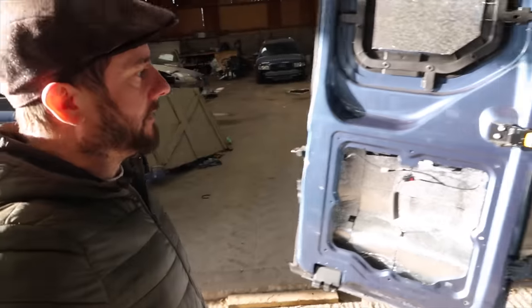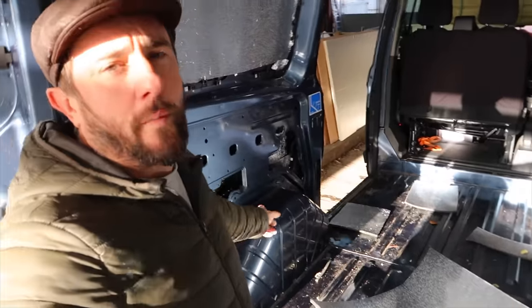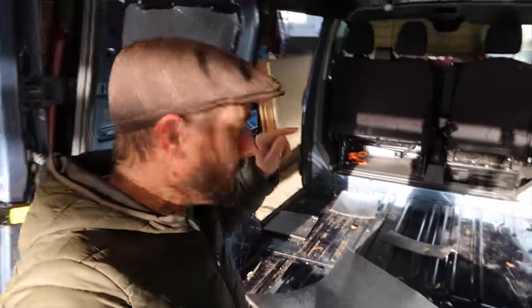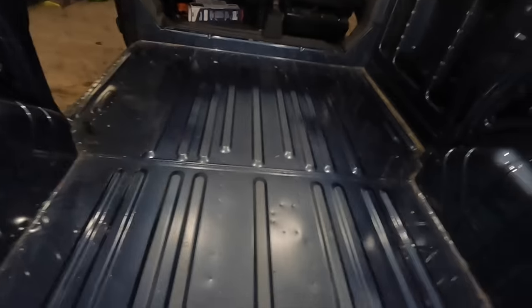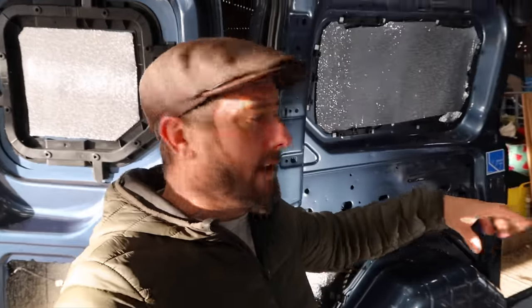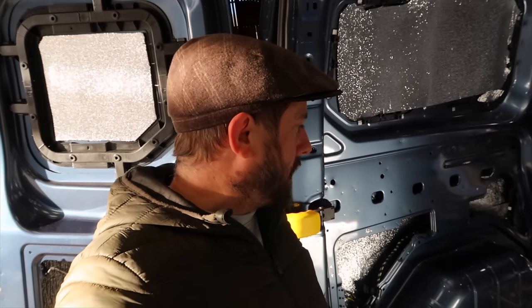Right, we're back again. Today's plan: we're gonna insulate the wheel arches, fill all the cavities with insulation, and then we're gonna clad the floor, which is a pain because all these raised bits are so close together. I wanna get a timber frame in there and then use Kingspan insulation in the gaps. So there's a lot of thinking and a lot of cutting of wood.